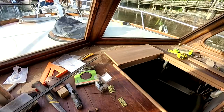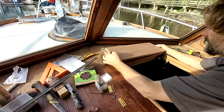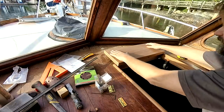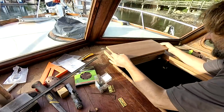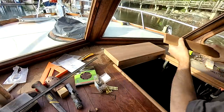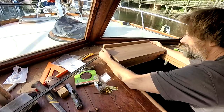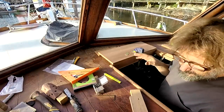The next panel goes on — it flips over and stays flush with the back edge. The third panel flips and ends up just like that. This thing just fits — it sits there with half an inch, seven-sixteenths of an inch clearance to the windshield. So this will flip over, and then the whole thing will flip over. Now this is fiddly work. As I mentioned, this is in its flipped-over position, and I've settled on the hinge sitting two and a half inches from the edge.